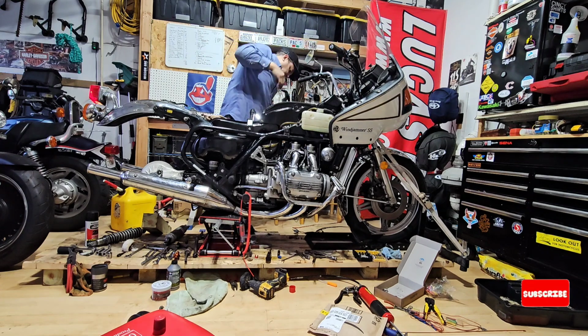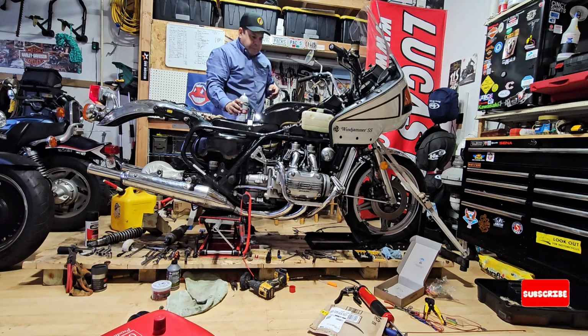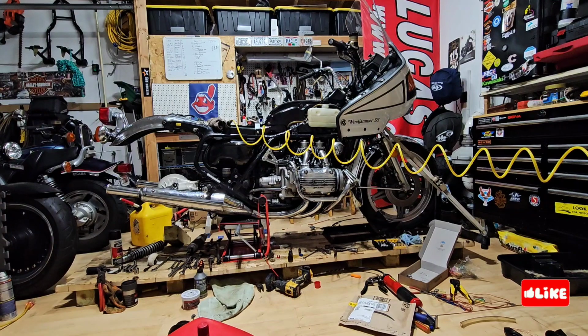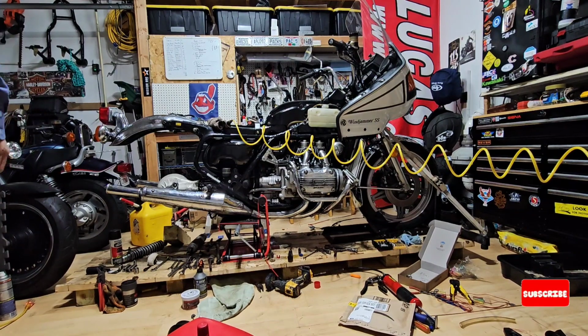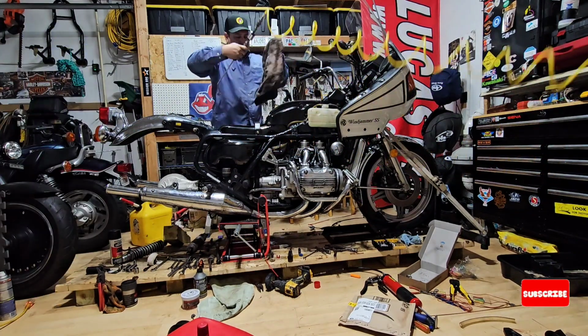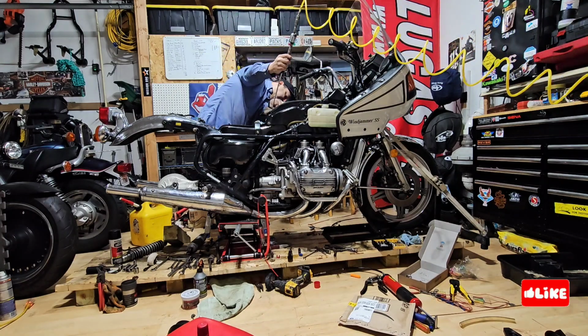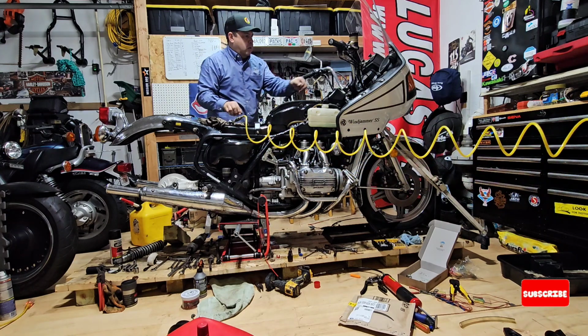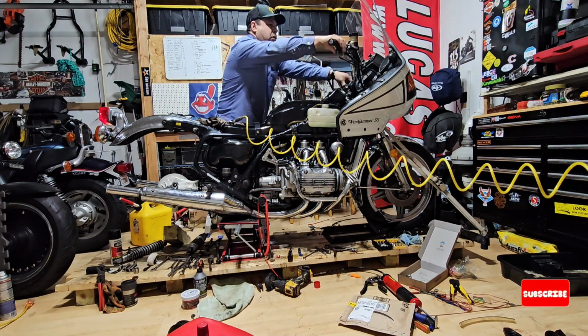From the tank to the fuel pump. So what I need to do now is kind of push the flow. Once it's flowing, it goes, but I don't know why it doesn't go by gravity. So now what I'm doing here is I will plug air with a rag and push it through so it fills the fuel filter.